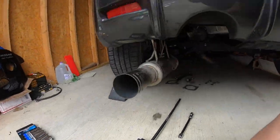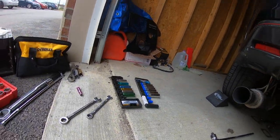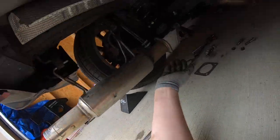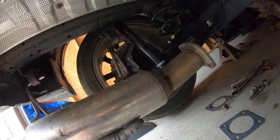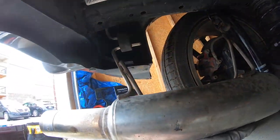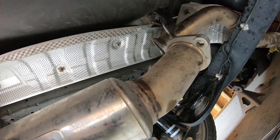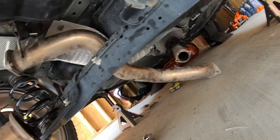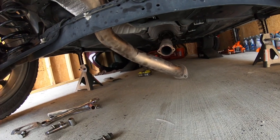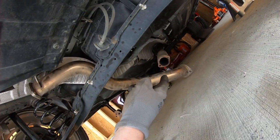All right, so I found the first interesting thing about this exhaust. When they made it, it looks like they split this exhaust piece into two. So you can see this guy has two hangers on one side, and the other hanger that used to suspend the muffler is on the other pipe. So actually all three of these pipes almost need to be connected for them to suspend each other. It seems like you could actually use another hanger over where those two guys meet.